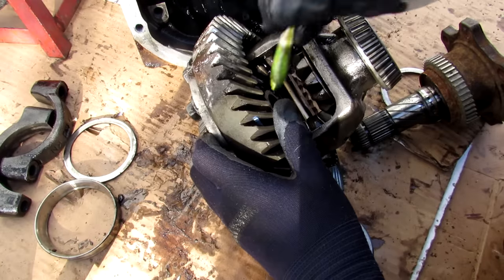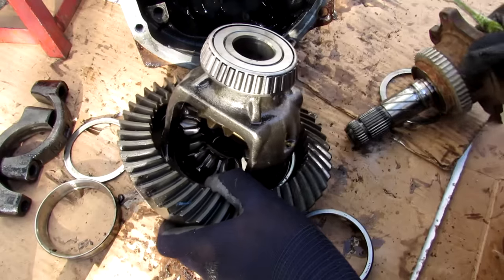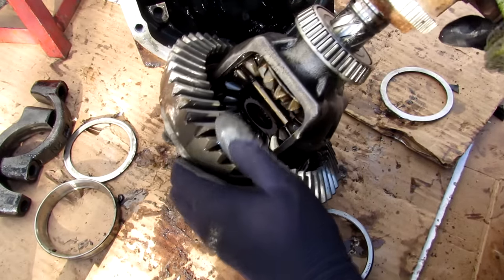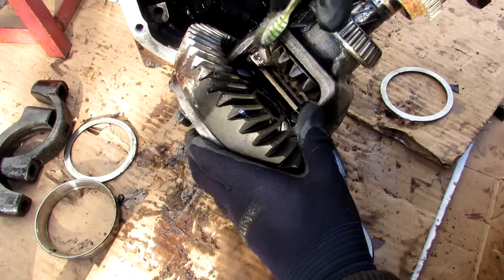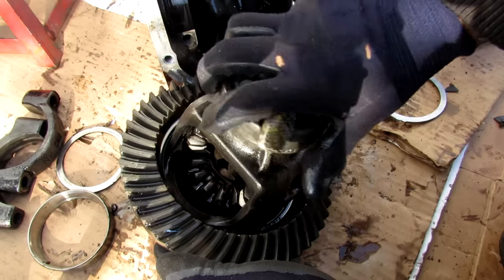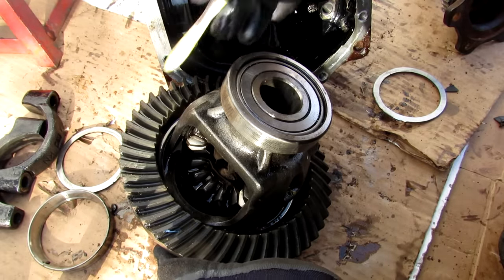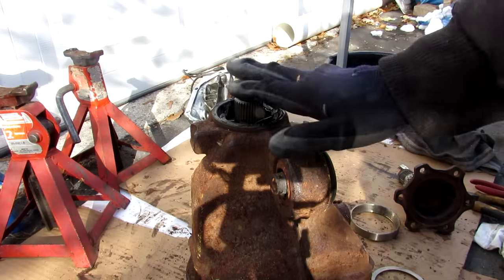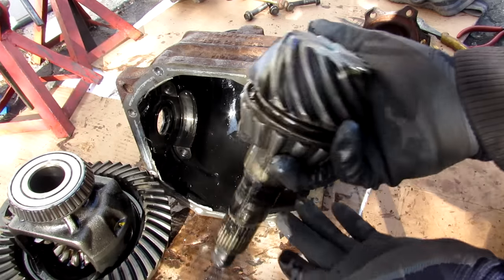Now it's important to note that the two gears on the outside here do not attach to this housing directly. The flange will bypass the housing through this bearing over here and connect to this little gear on the outside. The housing itself attaches to the differential casing through this bearing over here. Now the bearing itself has a conical surface area which is good for rotating, but it also allows it to absorb any axial forces that come because this ring gear is cut on an angle. Now in order to remove this pinion gear I'm going to use a special press.